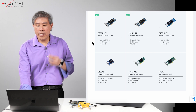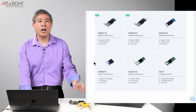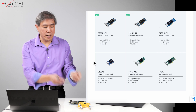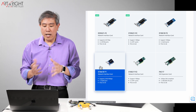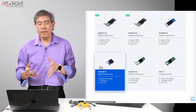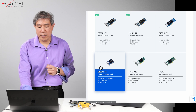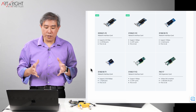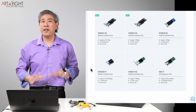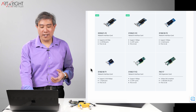For instance, if we take a regular simple 10 gigabit card that has one port using a copper RJ45 10GBASE-T connection — this is the E10G18-T1 — this one can do 2.5, 5, and also 10 gigabit networking. It has one RJ45 port and it is PCIe 3.0 x4. This card runs around $140 online, so it's not necessarily the cheapest card.